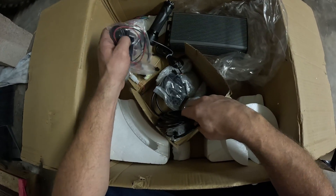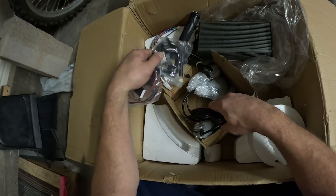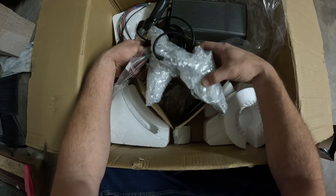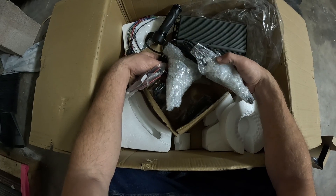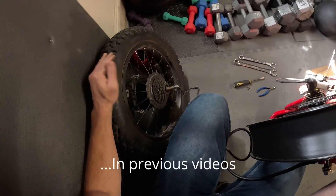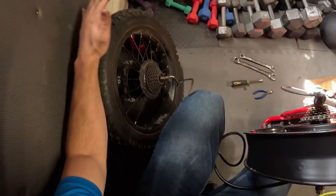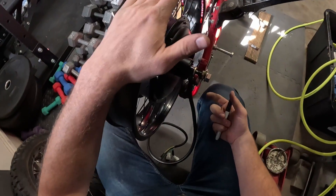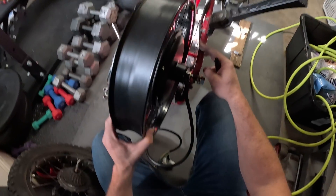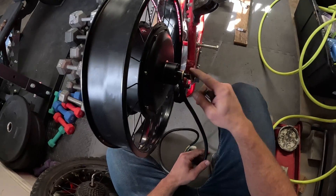The kit also came with a couple of extra parts. I think this is the mounting bracket for the controller, probably. This came with hydraulic disc brakes, so this should have the cutoff sensor when you pull the brakes. I've already done a bunch of this on camera, so I don't think I'm going to film all of this. All I need to do is take the inner tube and tire off, put it on here, connect this up, then screw this on with my torque arms. From there it's really just figuring out how to route these cables — that's kind of the plan.